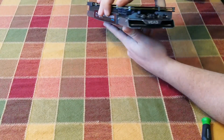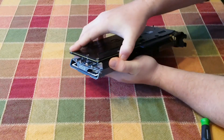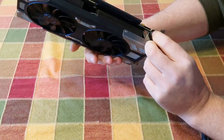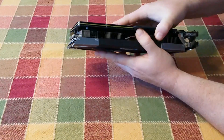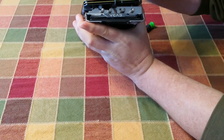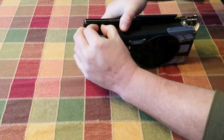I want to be careful because there are two headers on here — I think one's for the fan and the second one, which is right here, is for the LEDs. Let's go ahead and pry this apart. There is one more screw in the PCB down here that needs to come out as well. Now we're going to disconnect these wires — there's that one out, and then do the same for this one. They are definitely tight, but there we go.